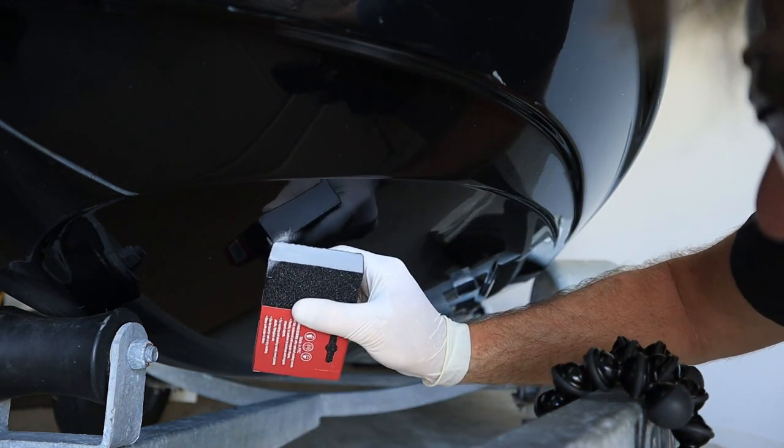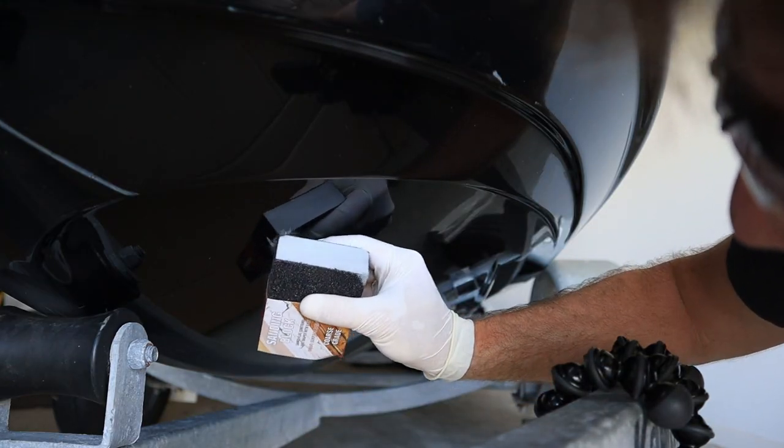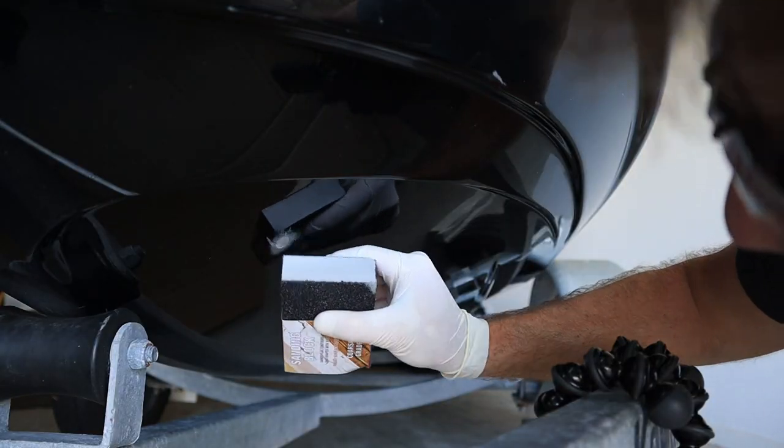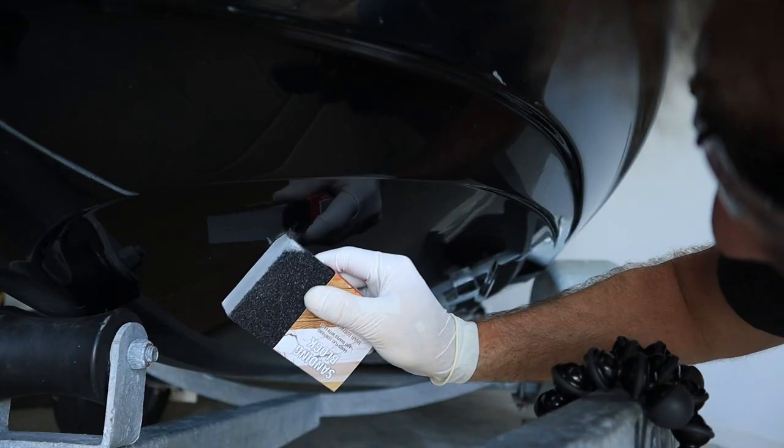You want to ensure that any loose or damaged gel coat is removed, the surface is roughened, all the margins are tapered, and the perimeter of the defect is rounded. You don't want a jagged boundary or any sharp corners.